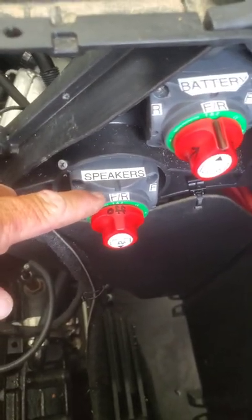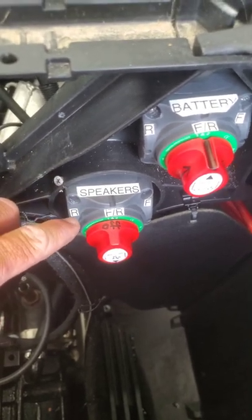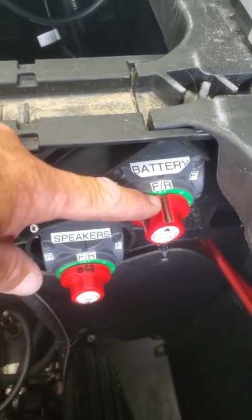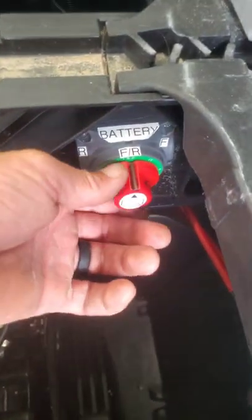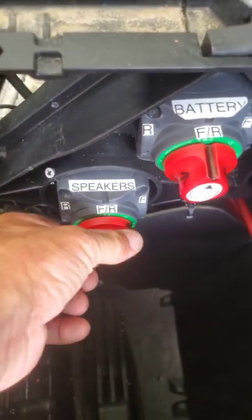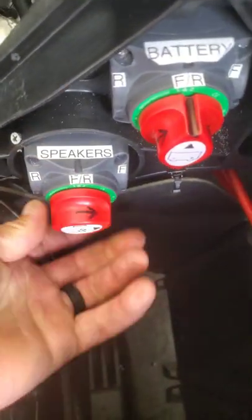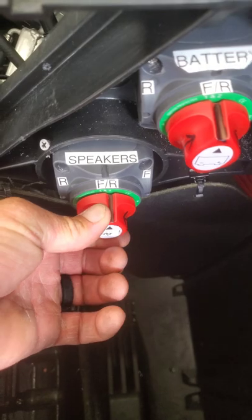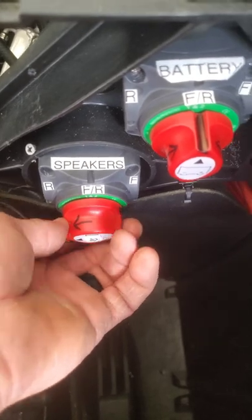Here's my secondary one I wired in for the speakers — front, rear, or front and rear. If I have it set to off, the speakers are turned off. If the battery is selected to front and rear, the charger charges the small one and the deep cycles up front. You can decide if you want to use those batteries or these batteries, or if you just want to play off your rear speakers, or the front, or all four. This works like if you're partying somewhere and they don't want to hear your music up front — you just turn it to the rear and you don't have to deal with anybody complaining.